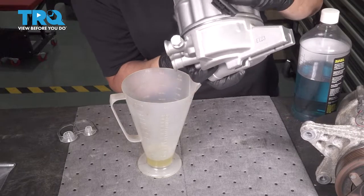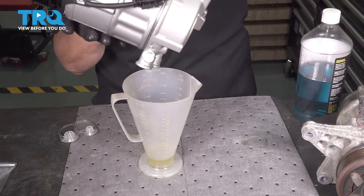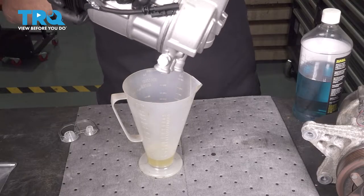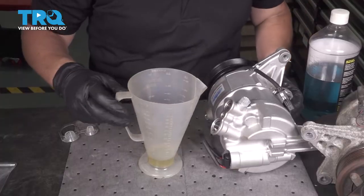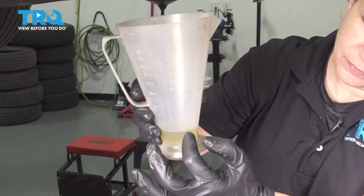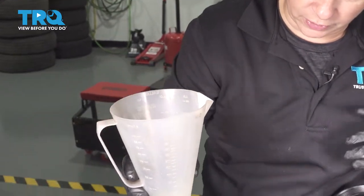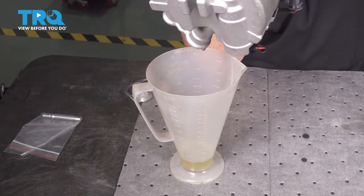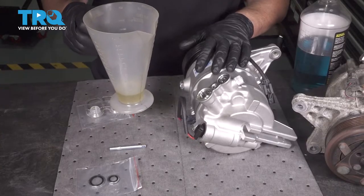As you can see, it's basically coming out of what I'd call the low side — the bigger port. See how I just tilt it and more comes out as it gathers in the back. I'm letting it settle and going to try again. This is about two ounces — imagine if you called for three and a half ounces and this was still in there, it'd be over full and would cause damage. So we'll just keep making sure we get the rest of it out. Now we're done emptying the shipping oil. I'm going to clean the cup so I can add fresh PAG oil.